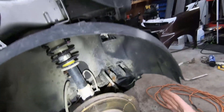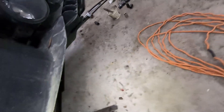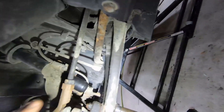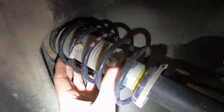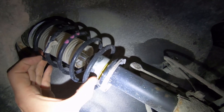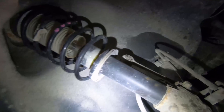In my case, I didn't have any play top to bottom and I didn't have any play left or right either. If there was play left to right, I'd check this tie rod end - a common place for these to fail, you get a bit of slop and weird steering. I am going to replace this since I'm in here, but it was actually in pretty good shape. Another thing to check is the spring - often the top ring of the spring breaks off, the spring shoots up and hits the body, and over bumps it'll be loose when the wheel extends fully, giving you a clunk.